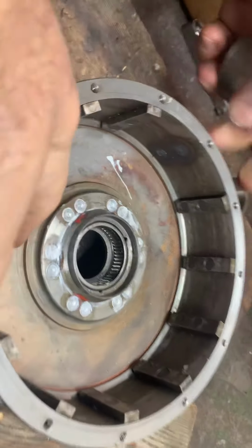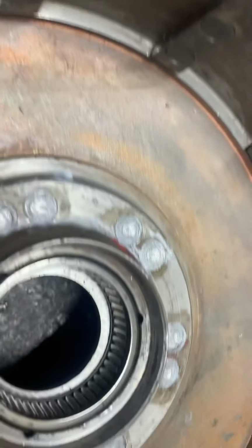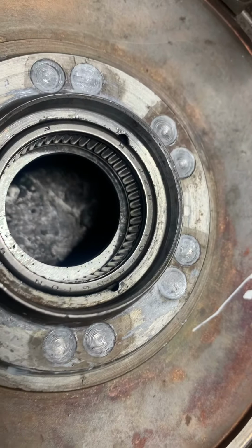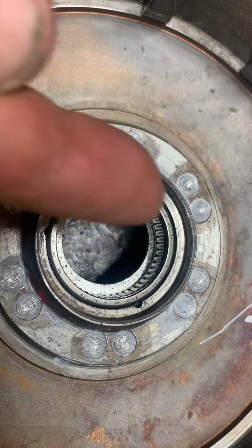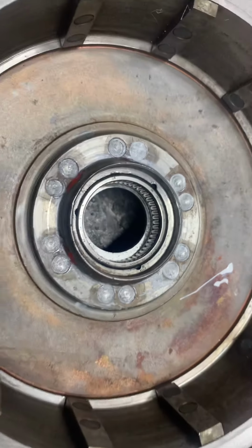Looks flush, and if you look close now, you can see that there's openings for all the drains. Oil. Yep. That one. And the earlier ones we showed where it wasn't open, right? Yeah, well, no. What happens is these drilled holes like this one walk towards the center sometimes, and you'd end up with no opening showing. The bearing closes it off.